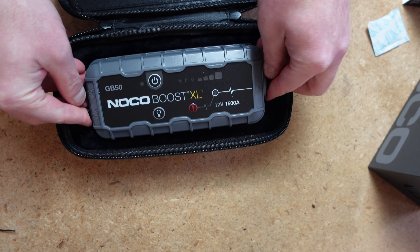Now it was only at three bars, and now it's at one, so I'm going to have to charge it up. I think I've got an intermittent parasitic drain somewhere that's causing a leak in the battery, and that's leading to occasionally not starting. Now it's charging. Let's check the voltage: 14.5 — that's what I'm used to seeing. But we've got all sorts of check engine lights now. Because the truck was at the bottom. That's interesting — 14.5 volts is what it's supposed to be charging to when it runs normally. It takes time for a lot of this stuff to calibrate — if you leave it for a day after putting in a new battery, apparently all the features come back and it'll test itself out.